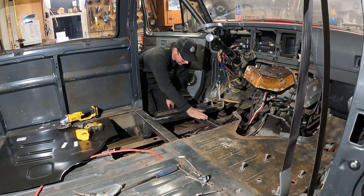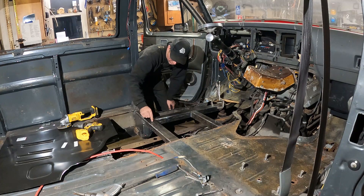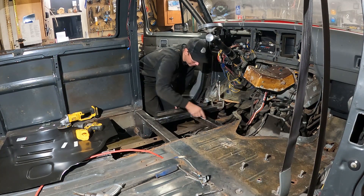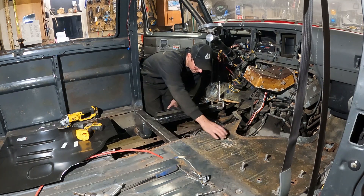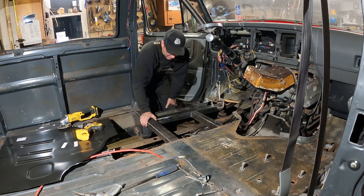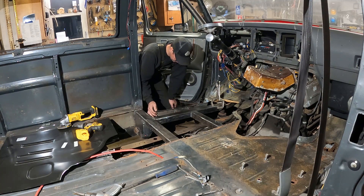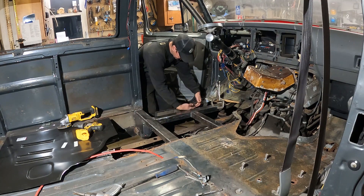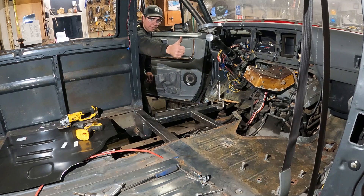I just got to do a little bit of top grinding to get this all cleaned up. I'm going to prime all these top surfaces so they're protected and not bare metal. When I drill the plug welds, they'll just grind a little bare spot for the plug welds to go to. I've got to do a lot of cleanup — clean all these edges up with a grinder, trim this back to get the floor fitted. I'm going to replace all this where all these holes are: drill out some spot welds and cut this about an inch back all the way around. That new floor panel will fit right in there. I've got the foot well — it's zip-screwed in place so I can work with it. Once I get it lined up on the floor, I'll stitch weld along here. It's a little thin, about 20 gauge, had some rust from the van it came out of, but it overlaps on the floor so it'll be okay.